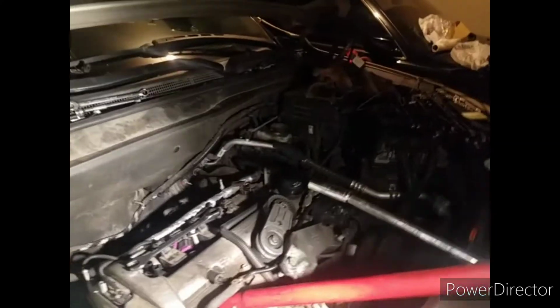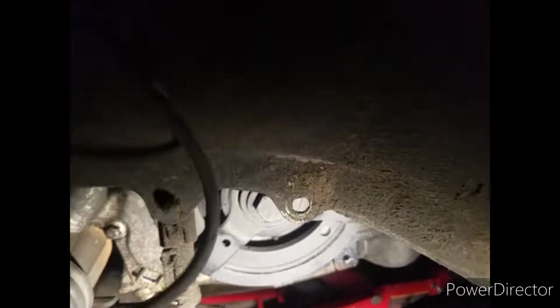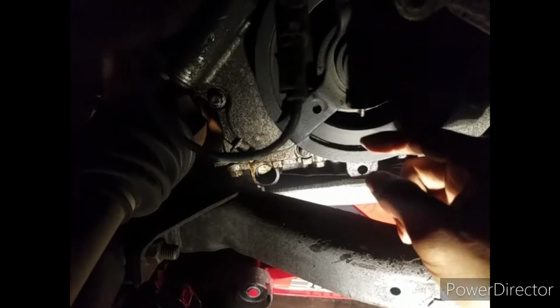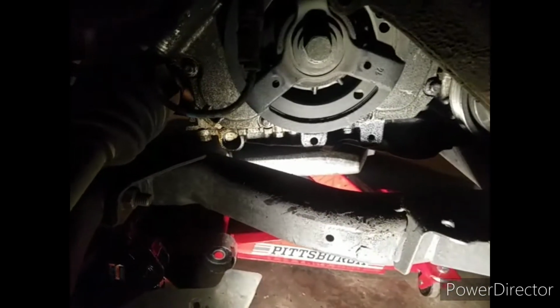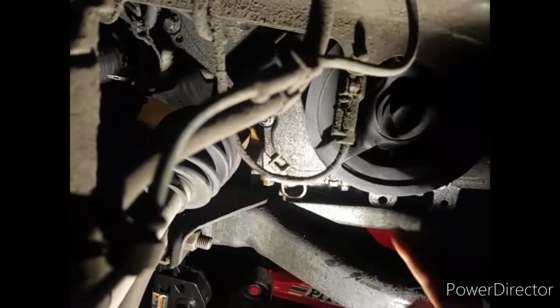And so we're down. Now I'm down here getting ready to pull this crank pulley off. I'm getting ready to take this bolt off to get this off. There's a bunch of little 10 millimeters that's going around. I'm gonna pop all those off. I already loosened all of them. So I'm gonna go and get all those popped off. And once I get all those popped off and this popped off, then we'll be ready to pull that cover off. And we already know there's a chain broken in there, but once we get that all off, then we'll be able to go in here and possibly put a whole new chain system in there, get all that redone, and then put it back together. So I'm going to proceed on to getting the pulley off and getting that cover off, and I'll come right back to you.